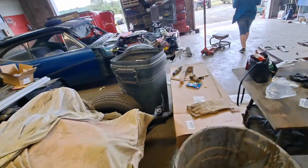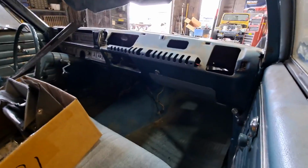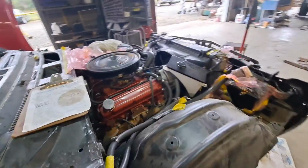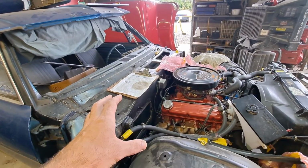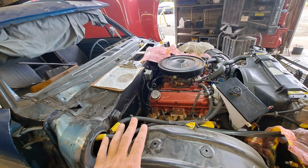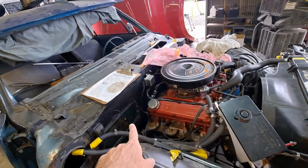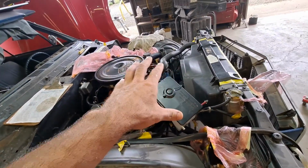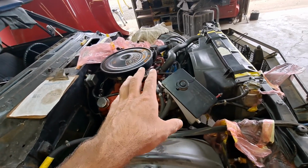Buick, we ordered vintage air conditioner for the Buick today. So we've got the dash all taken apart, dash pads pulled off, things out of it, heater box is out. There's no listing for Vintage Air for a Buick, so I'm doing a custom install between. So they're sending me an Oldsmobile kit. They have a kit for a 68 Oldsmobile that has the correct block offs for the heater fan and the heater box, the lines, the pump. They have bracketry for the rocket motor, so I'm getting bracketry for the rocket motor.